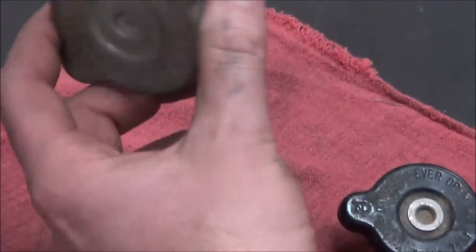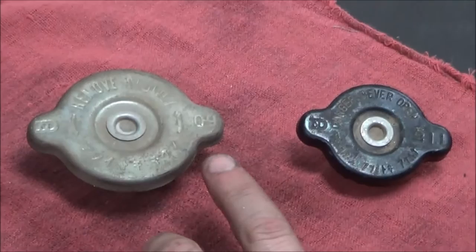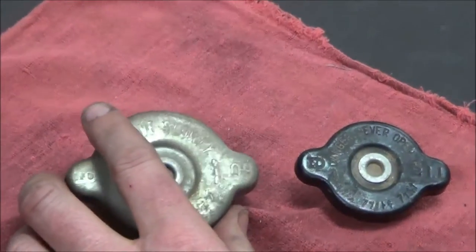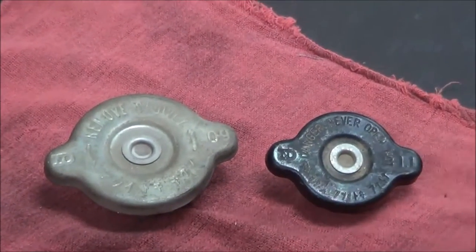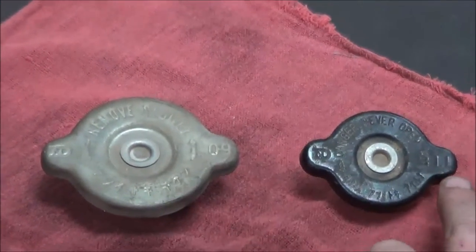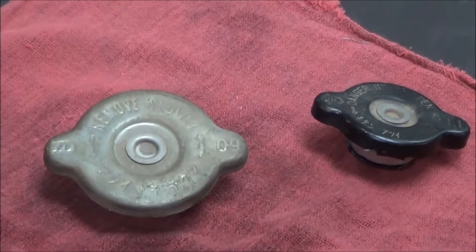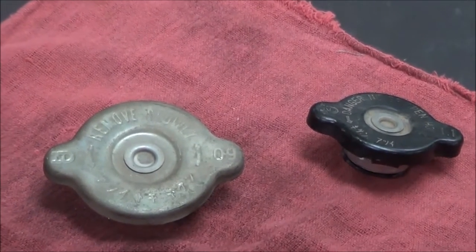A lot of guys go to the auto parts store now because those caps are much cheaper. I remember Honda guys on gold wings would laugh because the Honda Acura radiator cap was $12.95 and the same thing in a Honda Gold Wing wrapper was $50. But a guy came in with the wrong pressure-rated cap. If his cooling system was rated at 17 psi and he puts in a 15 psi cap, he has lowered the boiling point of the antifreeze and moved the system out of its operational range.